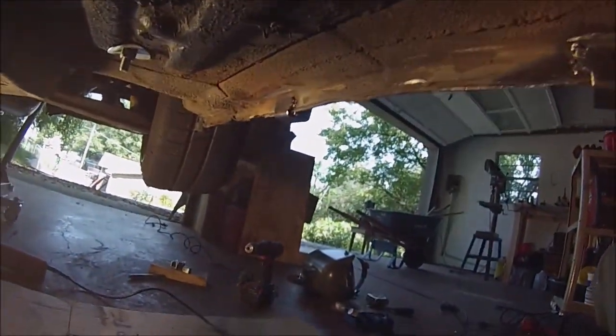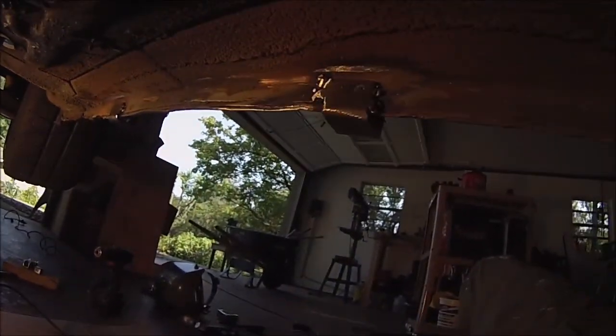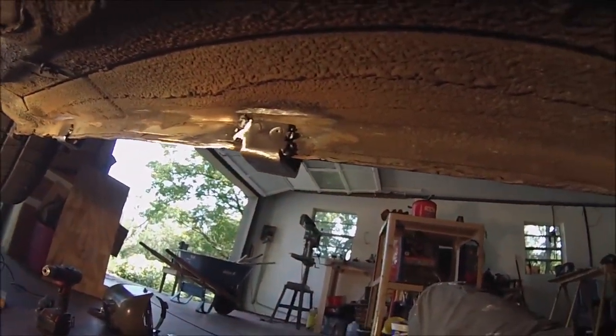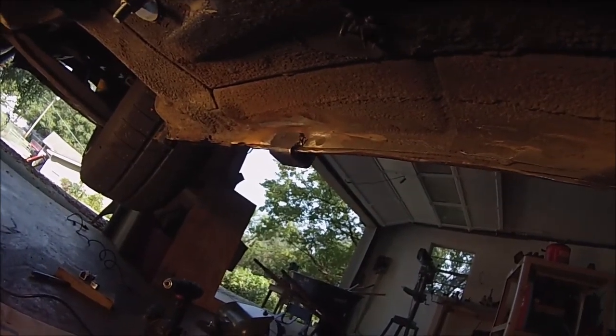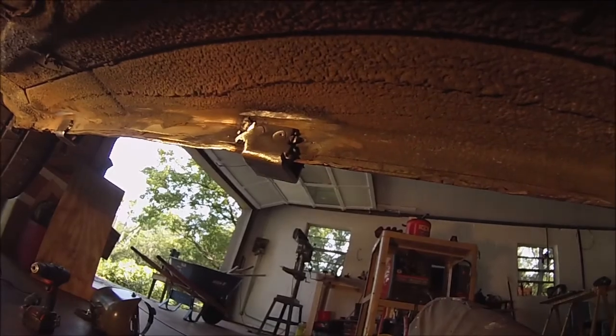I don't want to use too much heat in these because I'm afraid it's going to catch this stuff on fire. I've seen people do that before with the sealant in between, and then I've seen this rubberized coating also catch fire. I cleared it off as much as I could around it and stuff, but I just don't trust running a full bead along the top, bottom, and sides. I think these plug welds are going to be fine. And then the tacks that I did along the edges.